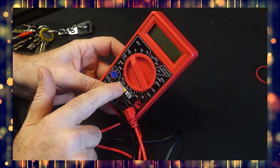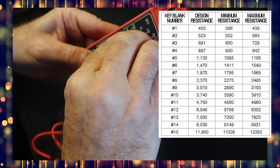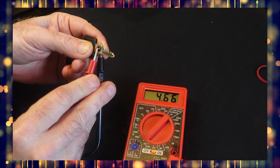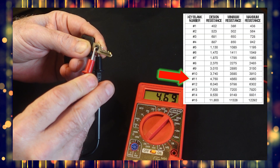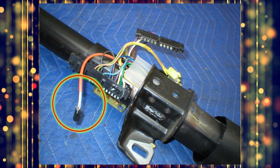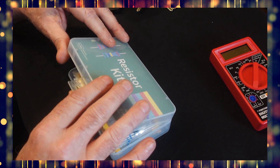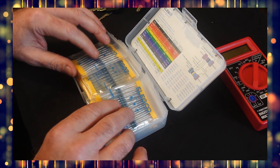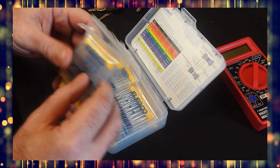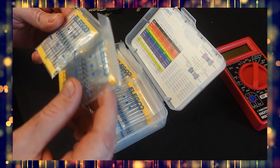Let's pull out the multimeter and check the resistance on my key. You can see on this chart there are 15 different key possibilities, each with different resistances. We'll put this on the 20k setting — we're getting a reading of 4.66, which falls into this range, making ours a key number 11. What we're going to do is find the long orange wire running down the steering column that has a couple of smaller white wires coming out of it that go into the car's computer. Right before the computer, we're going to add a series of resistors that add up to the correct ohms, hopefully tricking the system and bypassing the corrupted wire altogether. You'll still need the correct key to start the car, but the VATS system is negated entirely — in theory anyway.